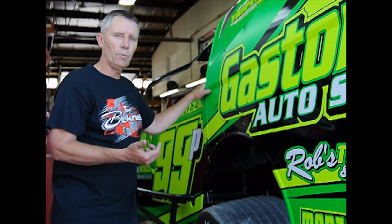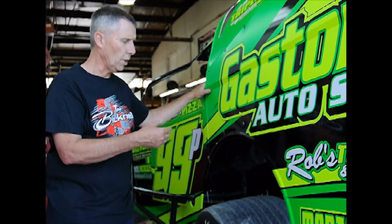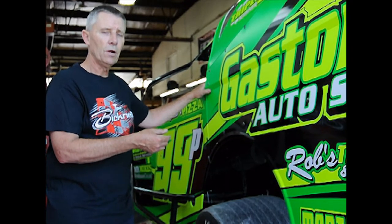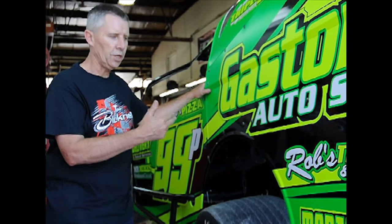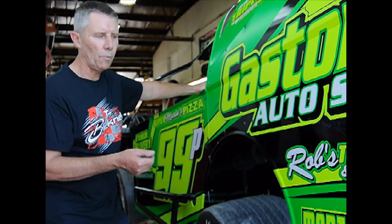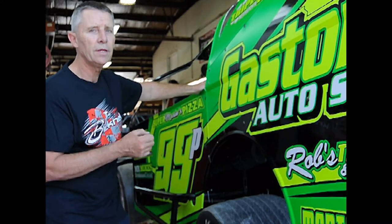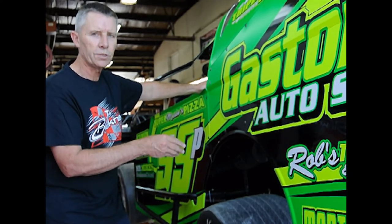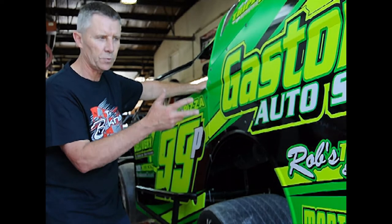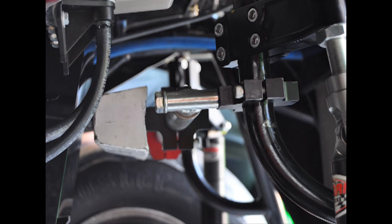Preferably I want 54.2 on the scales. Once we've achieved 54.2% left side weight with no ballast weight added, then we'll start adding lead weight. When we add lead weight, we're going to try to maintain 54.2% and achieve our proper rear percentage. For a small block car, I want around 65 to 65.5% rear weight — leaning toward 65% if the driver is heavier, or 65.3 to 65.5% if he's 180 lbs or less.